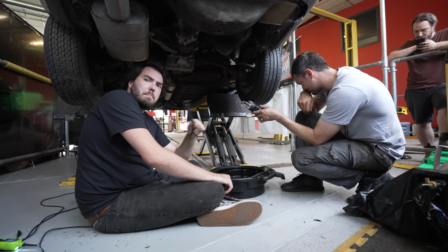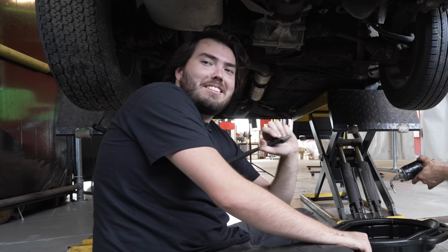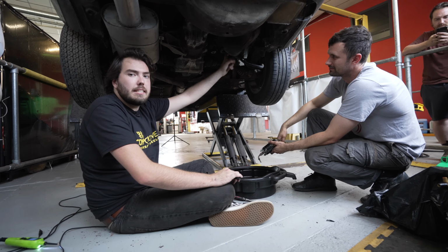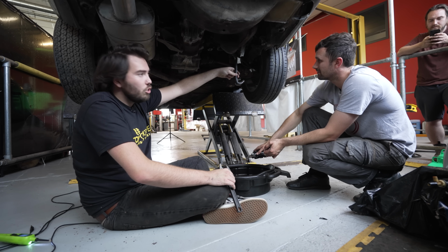Fuel pump out, but Ethan? That's right, there's 2 fuel pumps. There is an external fuel pump and an in-tank fuel pump. Now, we only actually need the external pump. Most 924 owners delete the in-tank pump because you don't need it. We're going to get rid of that because right now that is blocking most of our fine juice from leaving.